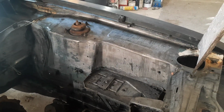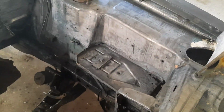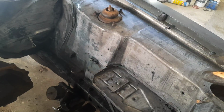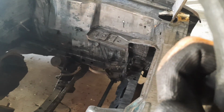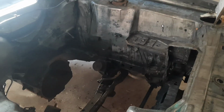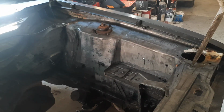So there you go. First half-hour session with the laser. I'm going to have a play with them settings. I'm going to work stuff out. But I did find that it's the user as well. If you had the laser close, you really heated up the panel, like hot. I kept touching it. You might have seen that. And it would just melt the gloves. You see them melted there in the end. Once I started standing back about three to four foot, red dot on it, just do it like that, and it's 200 mil, I'd say, 20 centimeters, the fan, and you just go across it. You can adjust all that. That's what I've got to work out. But I'm pretty happy with it, because that'll just save you tons of time.